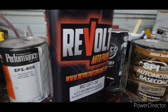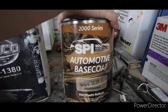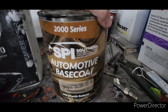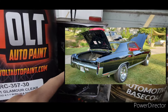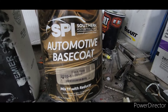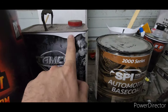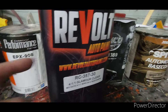Currently on the blocks I've got my '59 Chevy and it's going to be SPI black. I love this black base coat. It needs to go over 600 grit. Revolt and Tamco need to go over 320 — they're a lot thicker. SPI is a little more watery — Barry or Gary from SPI recommends 600 grit, so that's what we're going to do. Tamco's base is one to one, Orion's base was one to one, and Revolt's base is one to one as well.